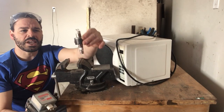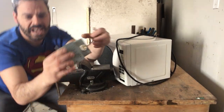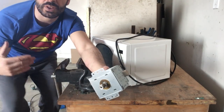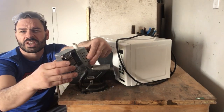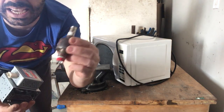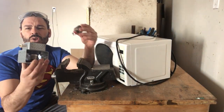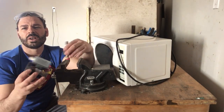The inner core has two ceramic ribbons that contain beryllium. You can actually see in this one that part of it is sticking out. It is okay to touch right now because it is not damaged. I'm going to have another video that shows you how to safely disassemble a magnetron without risking cracking that ceramic. As you can see inside, a friend from the UK showed me there's a nice chunk of copper in there — I scratched it and you can see that's copper right there. You definitely want to take the necessary precautions to safely and effectively scrap this so it does not harm you or anyone around you.